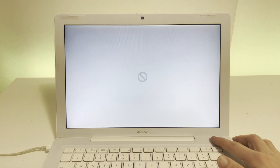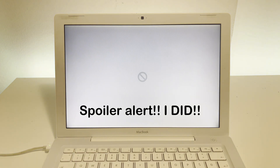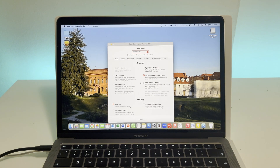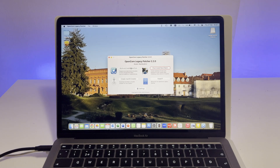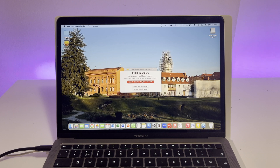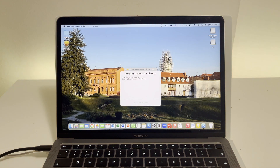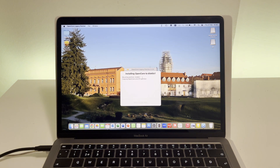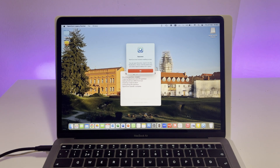We get this interesting icon — I'm not sure why that happens. Apparently I skipped a step on my modern MacBook. After selecting your Mac model in the settings — MacBook 5,2 is selected for me — you want to press return and then click 'build and install OpenCore.' Then click 'install to disk' and make sure your flash drive is selected, then click on the EFI volume. It will install OpenCore over to the flash drive. This is actually needed in order to get it onto unsupported machines, since OpenCore Patcher just creates a normal macOS Sequoia install USB and then you need to install this to get it on unsupported machines. After this finishes, we now get the actual OpenCore Patcher option.